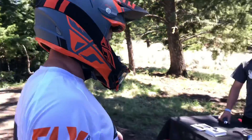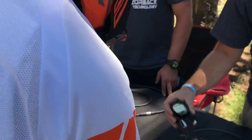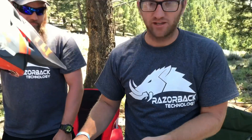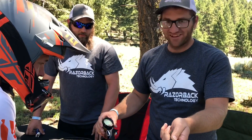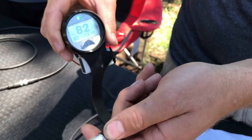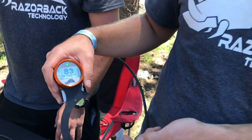Something about the hottest thing on your machine wins — that's just what I heard. So what do we got here? This is our infrared belt temperature gauge. It uses an infrared sensor to tell you how hot your belt is. You can see she's looking pretty good — not too hot over there. We've got a green light here; it turns yellow at 200°F. Anything below 200 is great — you're not losing any belt life. It turns red at 225°F.